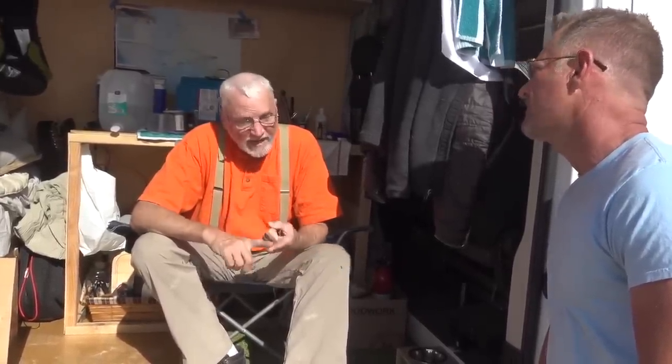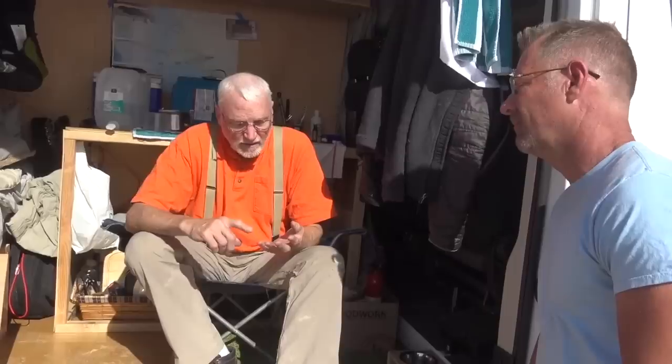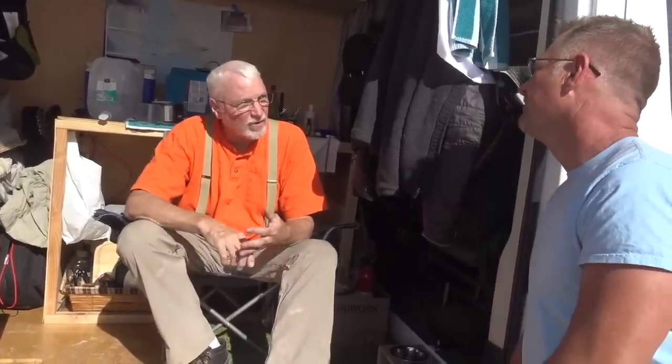I liked them at the time. I still like them. They're a lot of energy in a small space, and that's a good thing in a van. They're very rugged. They're built for vibration and shock and stuff like that. They're 12 volts to start with, so you don't have to put two of them in series or anything like that. I tend to size them so that you're not drawing them way down and way back up again. I only put them in with solar so that they're constantly getting recharged, because AGM doesn't like to sit in deep discharge for a long time.